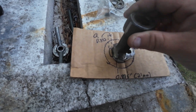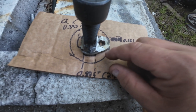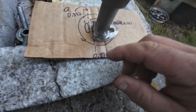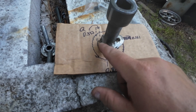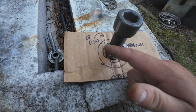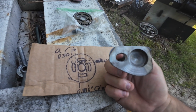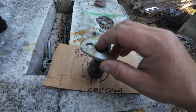When I made mine, I put a little slot in it to help me pick up the hole — you can see it's kind of a teardrop shape. At first I thought I'd be smart and pick up both holes in the camshaft, but if you try to pick up the one in the back, the chain gets in the way because it's still there when you're doing this. So I wound up cutting that portion off, which is pretty much how Aprilia makes theirs.